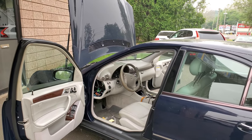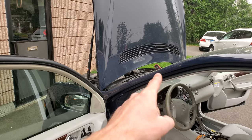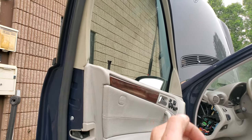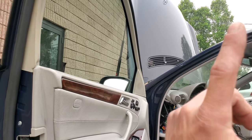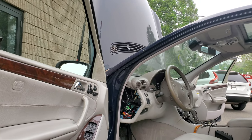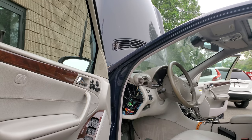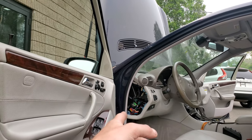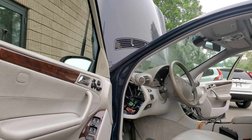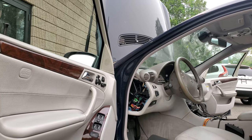With these cars you can have many different issues. The way I go about them is to come in here and start pulling fuses, watching my amp meter while the car is sleeping. Make sure your door is locked, the car is sleeping, and pull fuses one by one watching for the amperage to drop. Sometimes you have to pull a few; sometimes if the computer goes to sleep at the wrong time you'll need to reinsert a fuse for it to sleep properly. If you don't find anything in one fuse box, move on to the next. For me it was pretty simple — first fuse box I checked, I found two issues, and they were remedied within about an hour. The decoding was the toughest part.